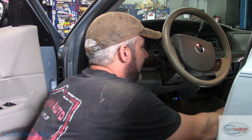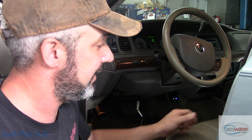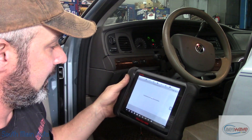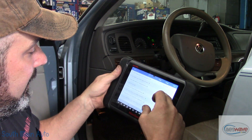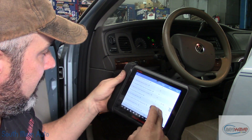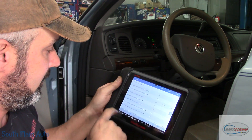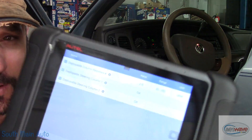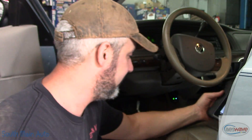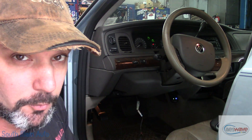So how do you test that? I'll show you and I'll show you the benefit of this kit, because those resistor values are not common. I looked at the steering column - the deployable steering column resistance. Let's pull that up on screen. You can see in scan data right now it's 2.6 ohms, and before it was reading 10.7, which I think the scan data interprets as open circuited.